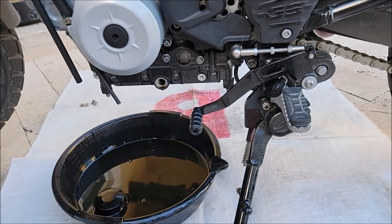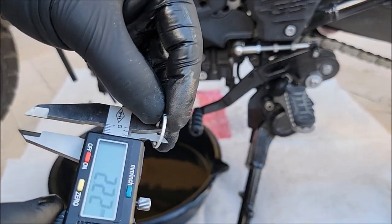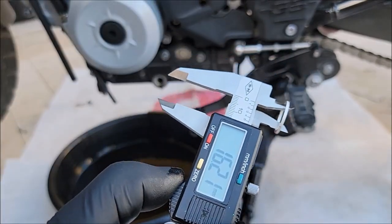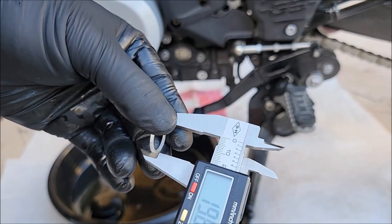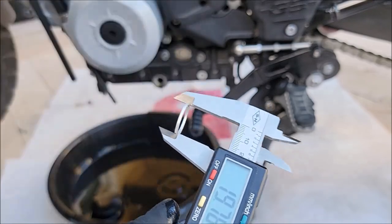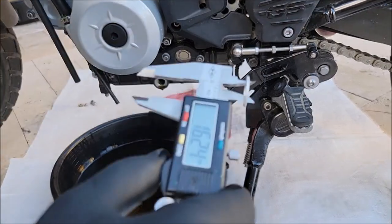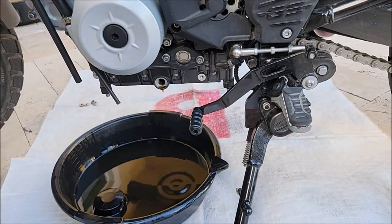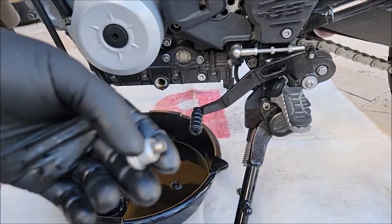I cleaned off the plug — the magnetic plug — and there's an aluminum washer in there. It's 16.2mm inner and 20mm on the outside, roughly by 1.5mm — it's an aluminum crush washer, 16 by 20 by 1.5. I reused the crush washer and it worked fine, no leaks. I just wasn't sure what size, so next time I'll probably reorder a couple ahead of time.